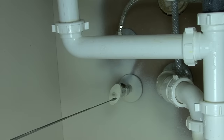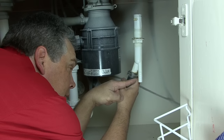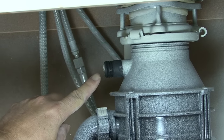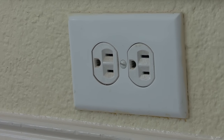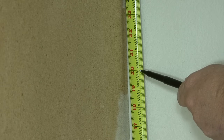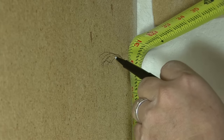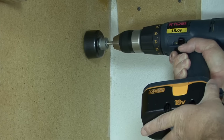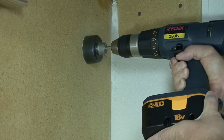Locate the water valve and the drain connection. In some homes there may be an air gap requirement. If the air gap is not being used, attach the drain line to the garbage disposal or the drain line itself. Locate the electrical connection. The drain hose should not be installed along the floor but about 20 inches above the floor. Measure and mark a spot to cut a hole in the cabinet wall about 5 to 6 inches in front of the back wall using a 2-inch hole saw, then cut the hole using the drill and hole saw.